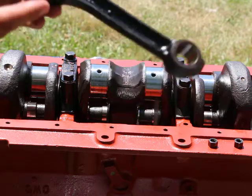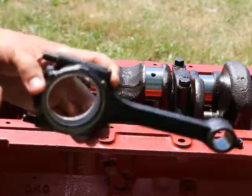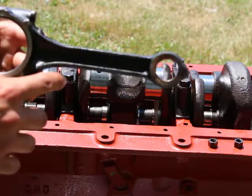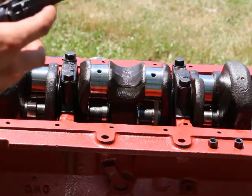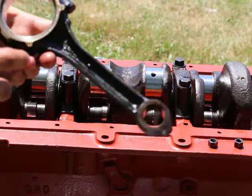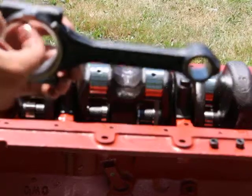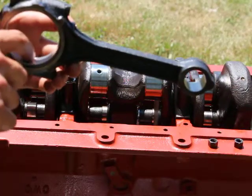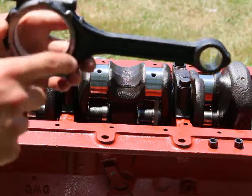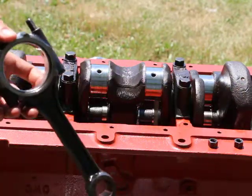Unfortunately, I don't know why the factory has different variations of these bearings, connecting rods, and connecting rod caps — it's really unfortunate. But although you can get a rod with the exact same forging number, they'll still be slightly different. So as long as you put your finger inside and everything's perfectly round — you can't feel the ridge, you can't feel the seam, not between the bearings, not between the sides of the caps and the connecting rods, not on the outer side — that's what matters.